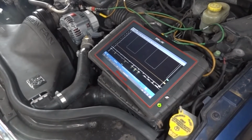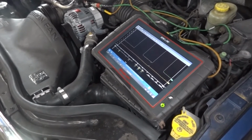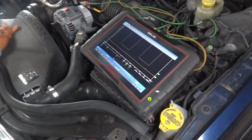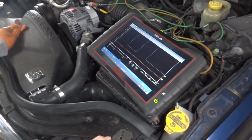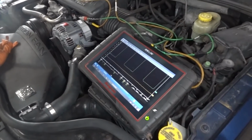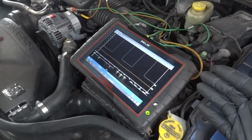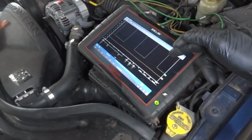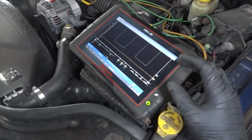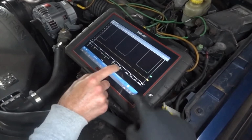Perfect. So the engine is running. Now let's see what we have on the lab scope screen. What do you see, Bishop? Wow. Can you tell the difference now? Oh yeah. Yeah, big difference. Very clean. Very clean spike. So we have some type of on and off control on the lab scope screen. Now you see how it's off the screen? Yeah. So to get everything in the screen, we're gonna have to increase our scale. So we're just gonna click over here.